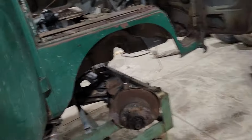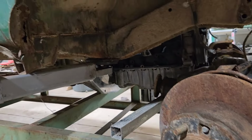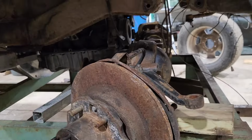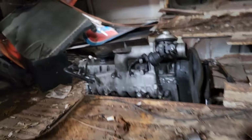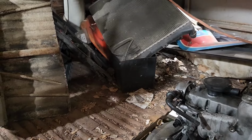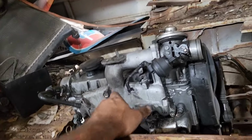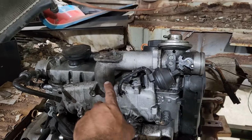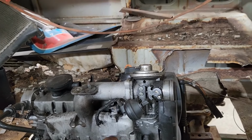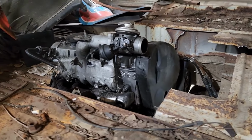And again, this is not going to be a strictly off-road vehicle, so I'm not as concerned. I can skid plate up the bottom and do something with that, or lower the axle just a little bit more. There's not really any room to raise the transmission and engine without getting way into the passenger compartment. But otherwise, everything fits pretty well. I need to consider doing something different with the intake, and also maybe redoing the valve cover to make the oil fill lower. But otherwise, it really does not take up that much space in the passenger compartment.